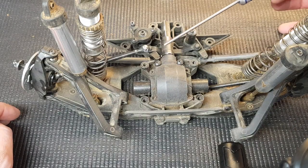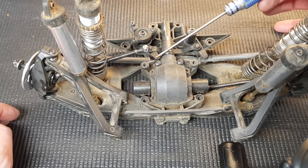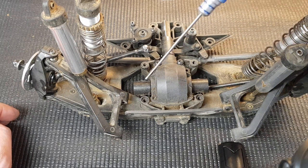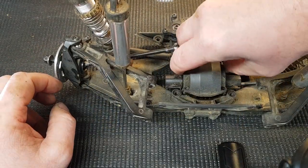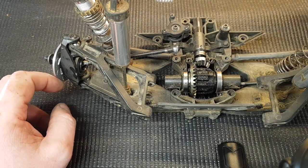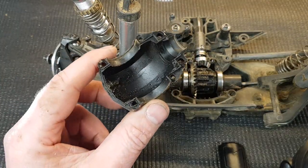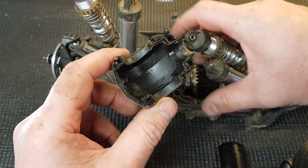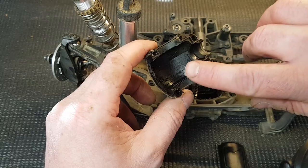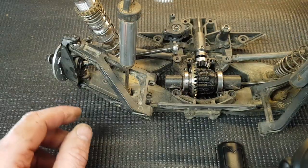To remove the differential there are six screws — one there, one there, and one at each corner of the actual casing. Remove those with a two-and-a-half millimeter hex. With those bolts removed, it should just be a case of removing the cover. That's reasonably clean — not too much grease packed in. You'll see some people pack this full of grease, but most of the grease spins off the gear so you don't need to go overboard.